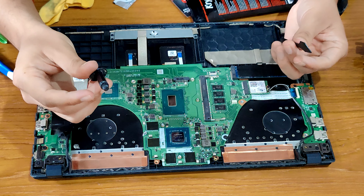I'm aligning the screw holes. The thermal paste must have spread inside. We're not going to remove the heat sink again, because if we do that it might cause air bubbles inside the thermal paste. The heat sink is now in place. Now it's time to screw the heat sink back on. Now we have our heat sink screwed back on. Now it's time to attach the fans back, but before attaching the fans let's clean them first.